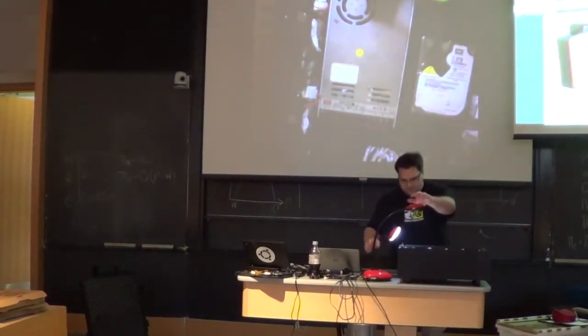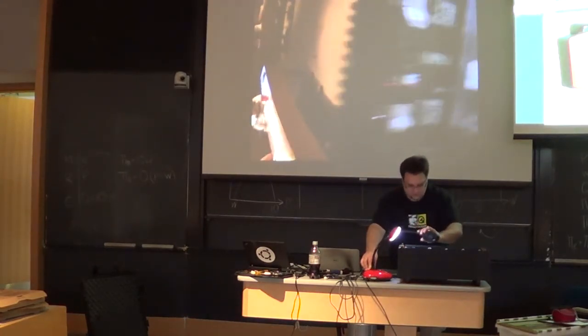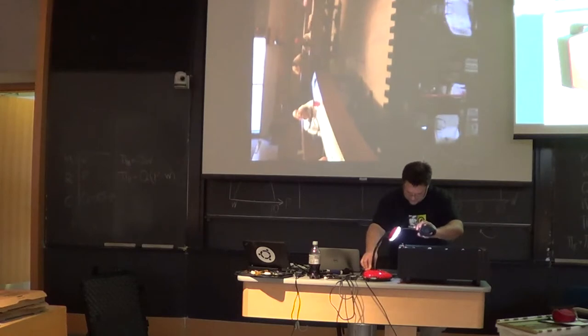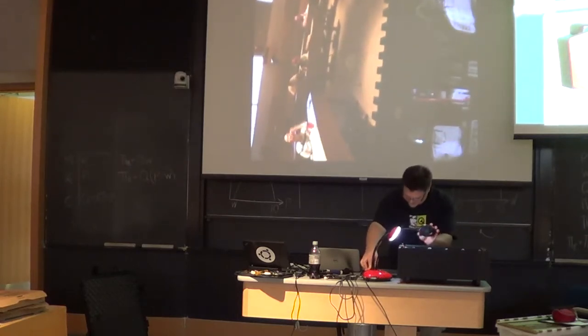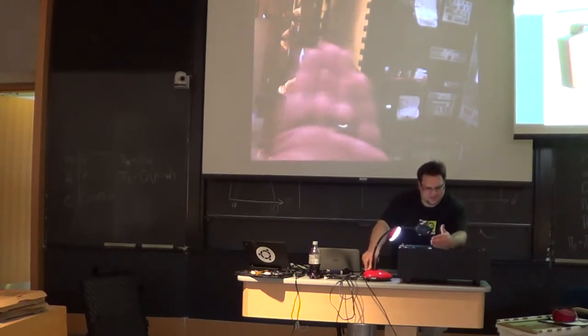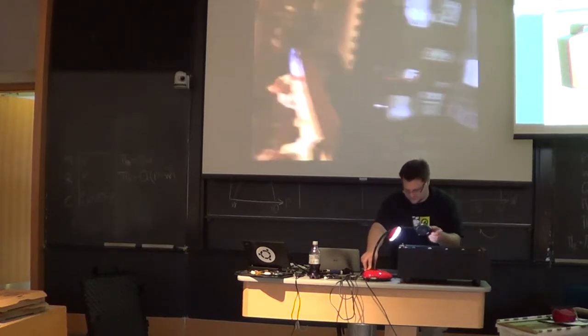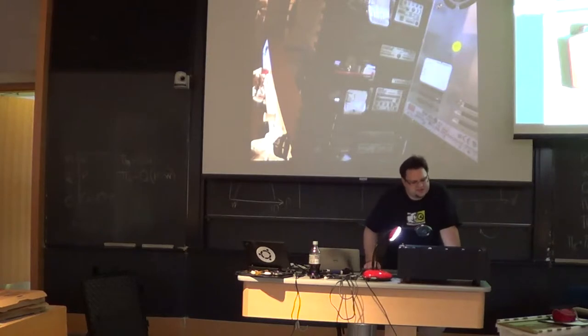The nodes themselves, this is actually a pretty cool shot, too bad you're not recording it, are lining the sides, as I was saying, with the CPU on the outside. They are all Intel NUCs. We chose a certain variant of the board that has AMT on board, so that we can do power on, power off from software. That's what dictated the selection. These have quite a bit of RAM, so they work quite well for us.